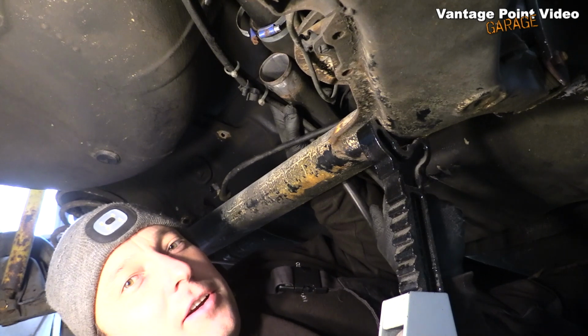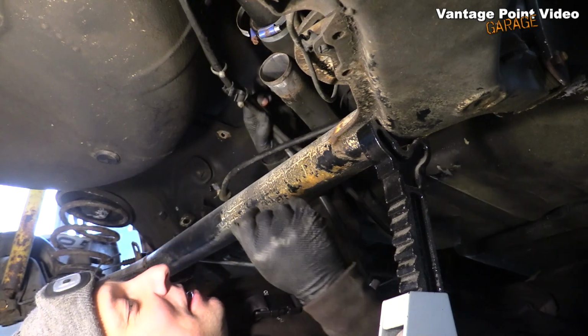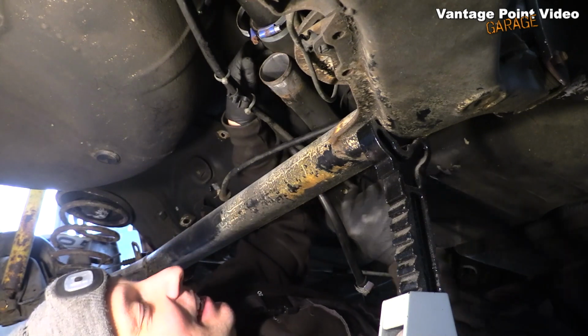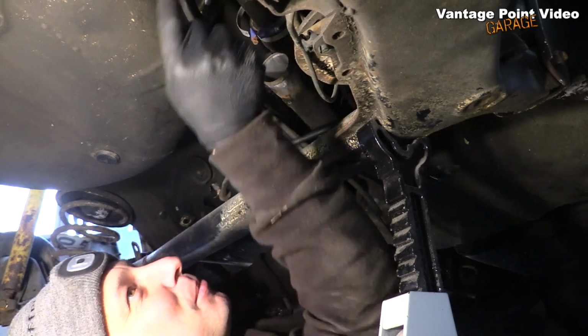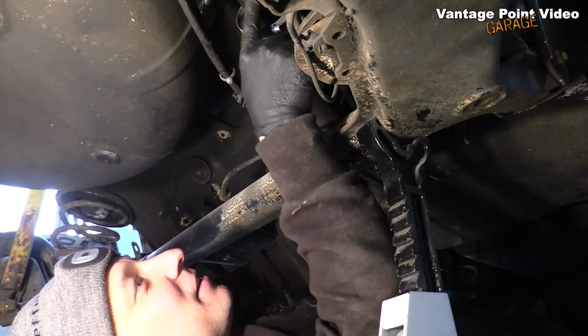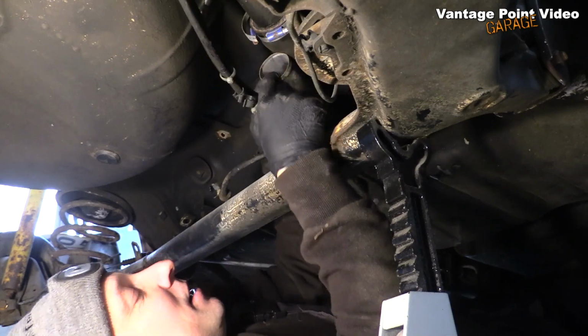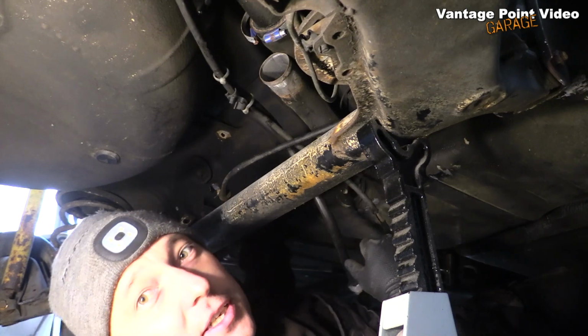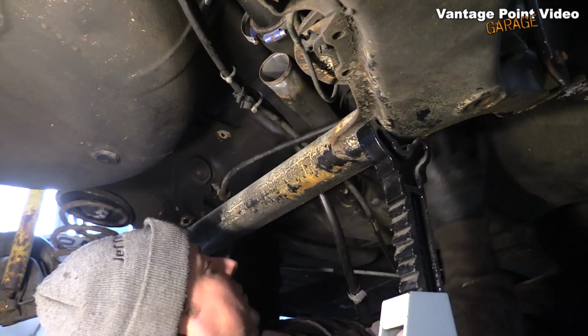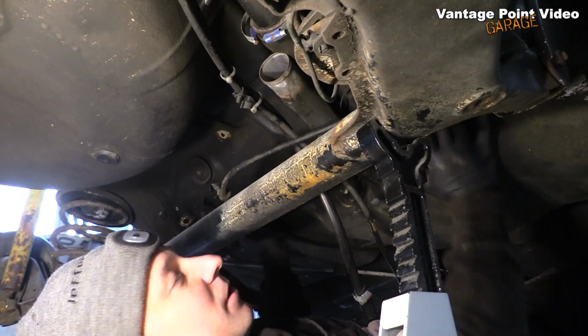I noticed when I was down here earlier for the handbrake cable that the fuel tank isn't connected up, and actually there would have been a cascade of petrol if anyone had poured fuel down that filler neck. It's supposed to go in there. So I'll have to lower the tank a little bit because there's another one loose that goes in on top, and that'd be a little bit awkward to do with it so tight to the body.